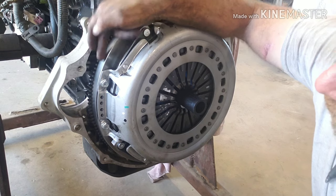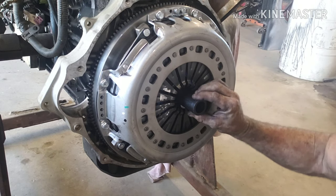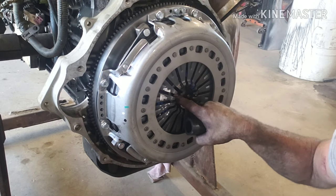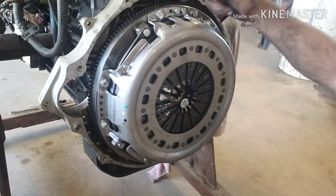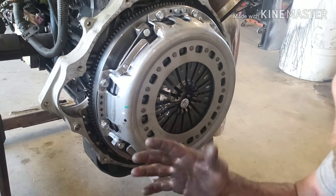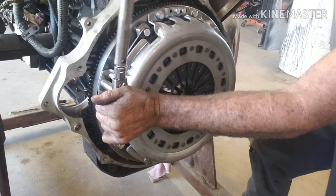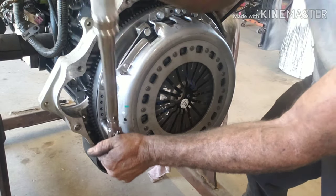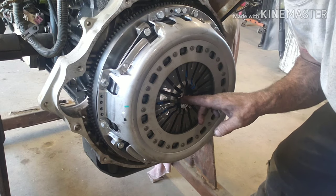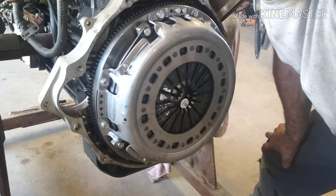We tightened the bolts down just to where the pressure plate is flush with the flywheel. All of our fingers on the pressure plate are now flat, which is exactly what we wanted — that means we're aligned. This can even come in and out now. The disc won't move because there's already spring pressure on it, so we're actually done with the alignment tool. Now we've got to torque every bolt down to 17 foot-pounds, just in a crisscross pattern. You're not going to need to hold it because you're only going to 17 pounds. Now we've got a clutch installed and we're ready to throw our transmission in. In the next video I'll show you how to put the master cylinder and slave cylinder on — hope you guys check it out, thank you.